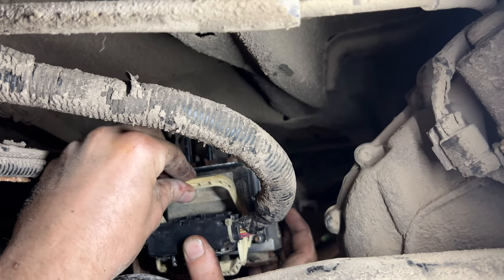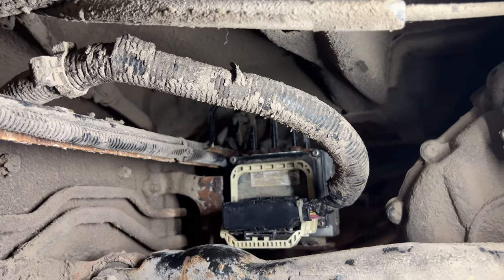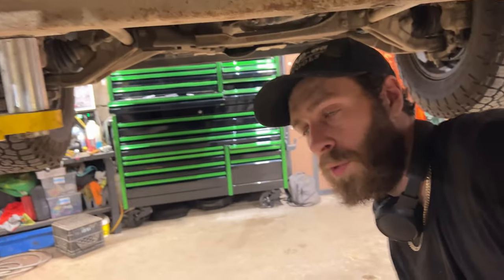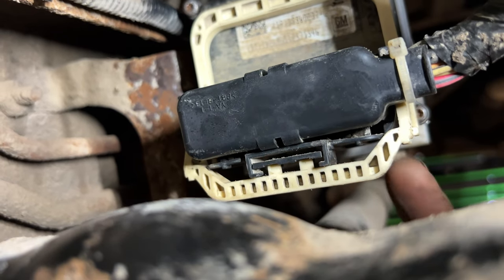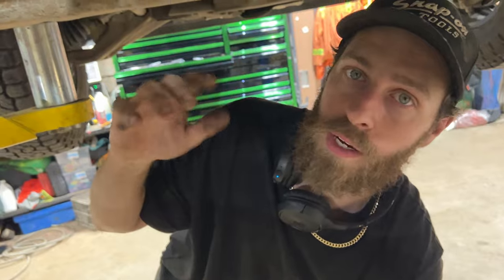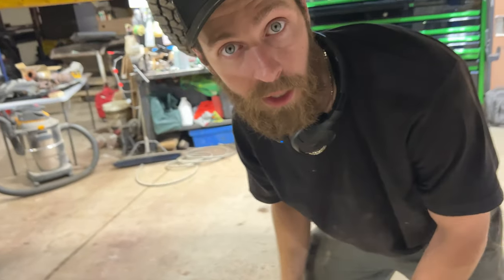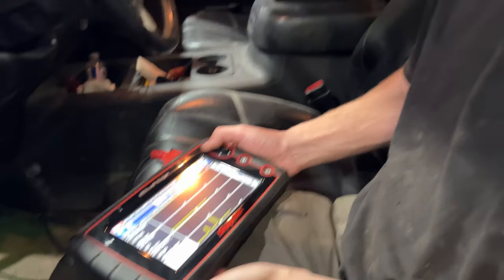It just slides on, and once it's on, there are plastic ears on the side — you push the connector locking tab forward and it snaps into place. Be careful when taking these off: there's a tab you need to push down to disengage the connector. If you go reaming on the white locking tab portion, there's a good chance you'll break those little ears off and you won't be able to lock the connector onto the ABS module — not good. Be easy with it, and use silicone spray in a can to help the plastic slide so connectors come off much nicer.